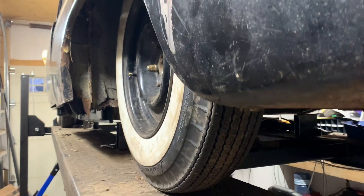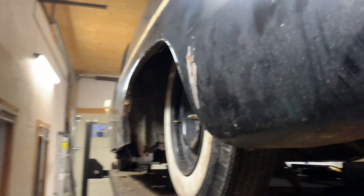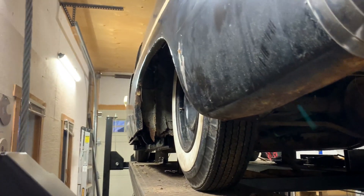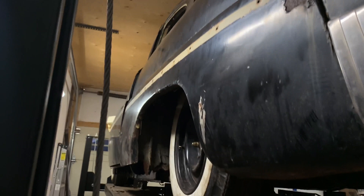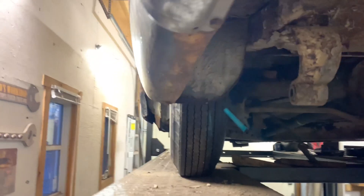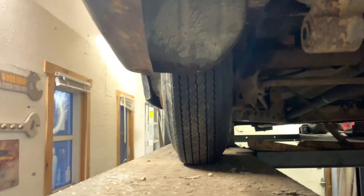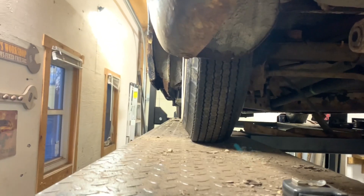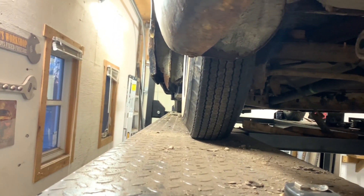That's where the six inches to the frame is, which is what those back blocks are. These are my tires — 670-15s. Once they're in a little bit far with those wheels, they look kind of silly, I think. This fender is also just floating there in the front, so maybe once that's stuffed up in. But I think I might need some wheel spacers or some different wheels — the offset is too far in. So we may need some different offset wheels, but that's where we're at with that.